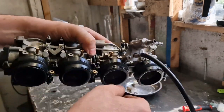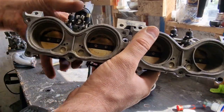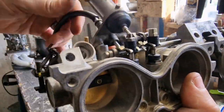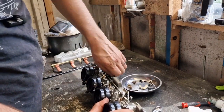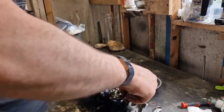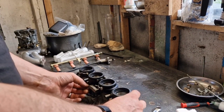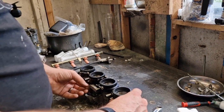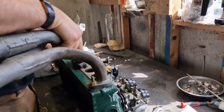Next up is the cold start - there's an idle air control valve here that works a bit like a choke. It moves a shaft that runs across and opens essentially the choke to all four cylinders. I'm not sure whether I'm going to keep this or not. It's just quite a lot of screws holding it together but everything came out pretty easily - I was quite surprised, expected one to be seized. Once I've got that shaft out, I can split the throttle bodies - M5 bolt, one at the top and one at the bottom - and they'll part really easily.